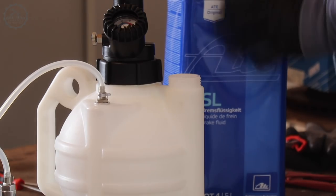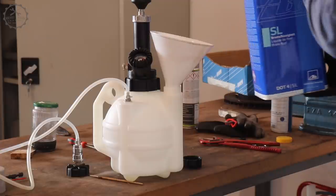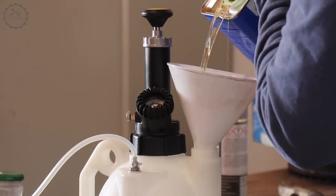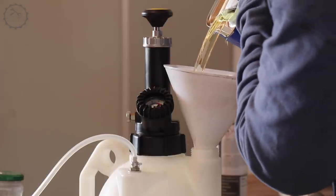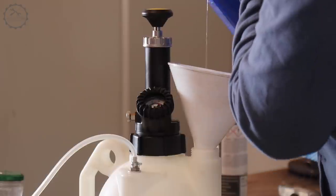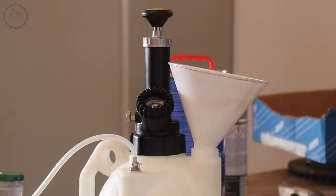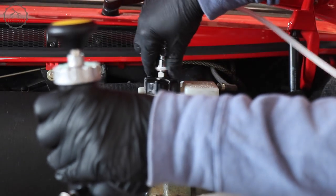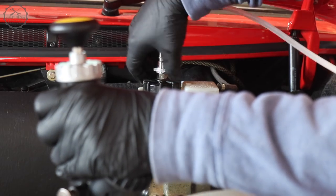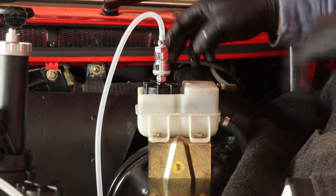At this point, people normally say that brake fluid unfortunately is hygroscopic and therefore it needs to be changed regularly. But guys, it's a feature, not a bug. If the brake fluid wouldn't absorb water, there would soon be water drops in the system that are corrosive and that would freeze and clog the lines. So if someone offers non-hygroscopic brake fluid to you, I suggest you decline. The device I'm using here consists of a pressure accumulator and a hand pump and a reservoir to be filled with brake fluid. Once used brake fluid is allowed to escape at the other end, the system simply pushes fresh one into it. And that's all.